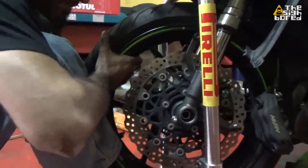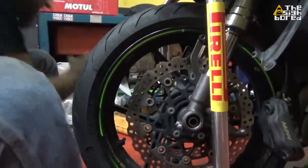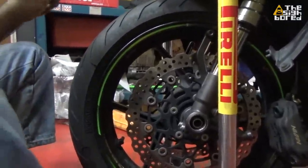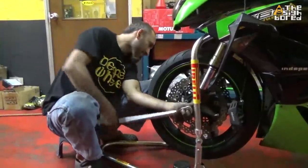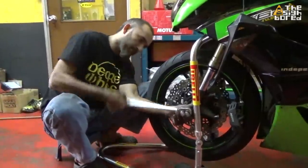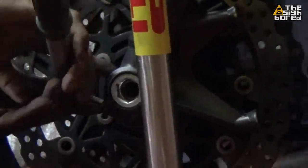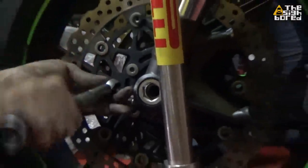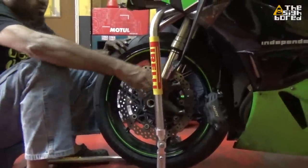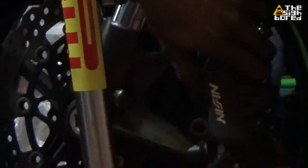Here we are almost done, putting the tire back and pulling back all the fairing bolts. If someone comes with an impact gun and over-tightens the fairing bolts — a lot of people have cracked their lower fairing here. If it cracks, you have to buy a new one — the whole lower part including the chrome comes together. That's about 2,000 ringgit per side. So just hand-tighten those fairing bolts.